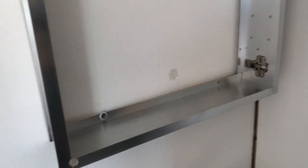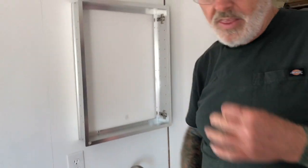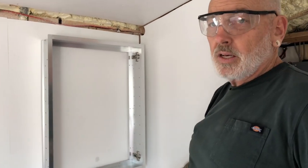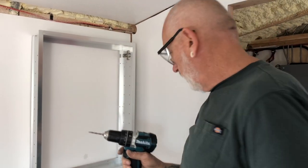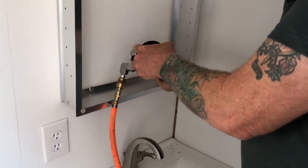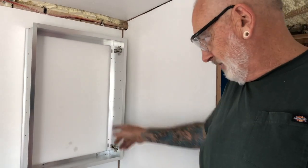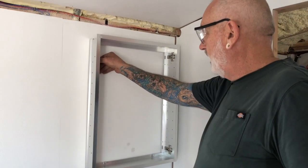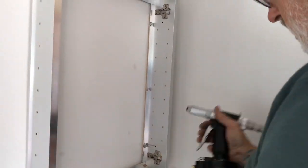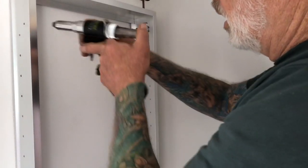Watch out for that little oil spot from the pop rivet — you can wipe it off. Because of all the things behind the walls, I've been really careful. I know my wires are right here and the other wires are in conduit, but I just want to poke through that quarter inch plywood and make that connection. That ain't gonna go nowhere now. If you ever want it off, just take a 3/16 drill bit and drill those heads off. I'll go cut my filler strips — without them it's gonna bend, because there's a gap where the mirror was that needs to be filled or else it'll just bend that metal down.